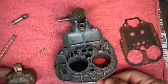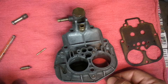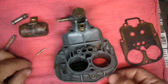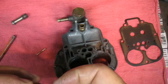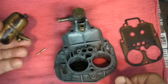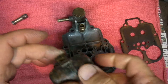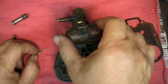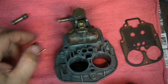I solved a problem with my idle and thought I'd go through what I probably should have done. It's common procedure to check your float level. I probably checked it and it went out of adjustment or something happened. My float level, instead of being six millimeters, it was probably ten or eight — something like that.